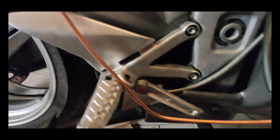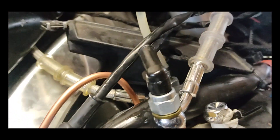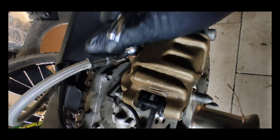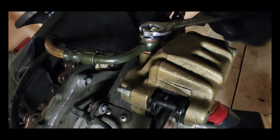What I didn't realize is that the stop screw of the rear brake lever was in a completely wrong position, which means that the piston of the master cylinder didn't have enough travel to bleed successfully. Not knowing that, I blamed long brake lines and possible air gaps, siphons and places the air bubbles could hide. So I replaced all brake lines and used copper lines instead. At least I don't have to worry about heat resistance near the exhaust — a year ago I had a brake line failure due to overheating on this spot and was left without rear brake on a two-day trip.